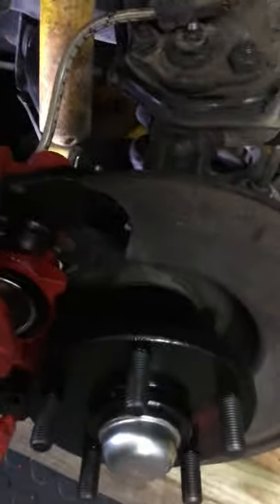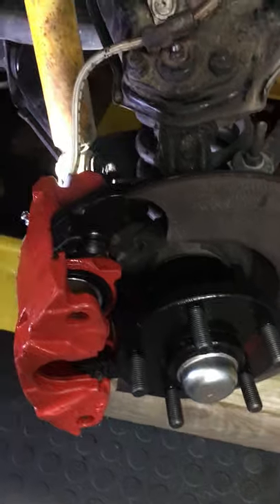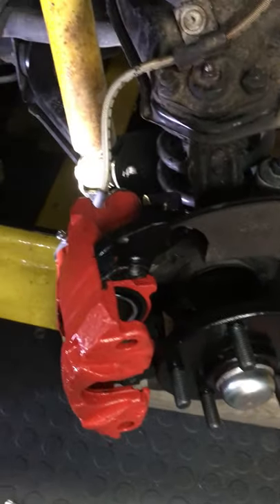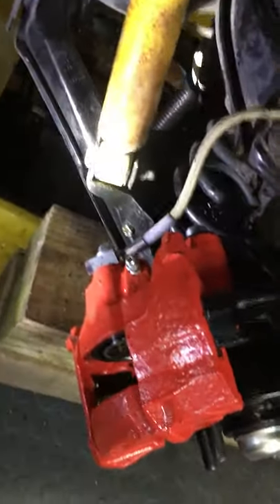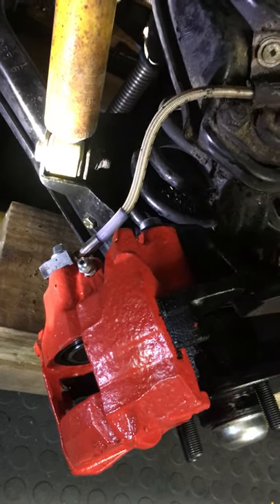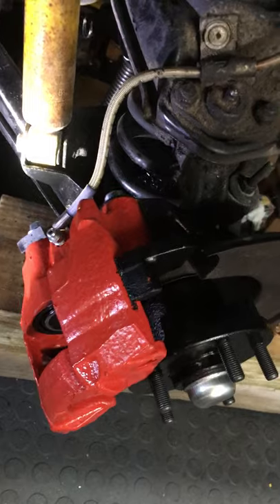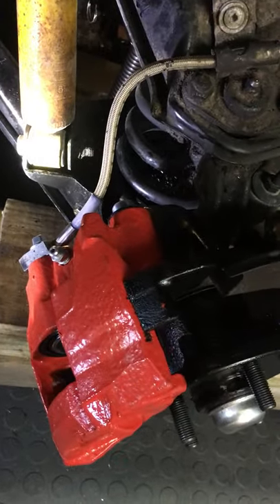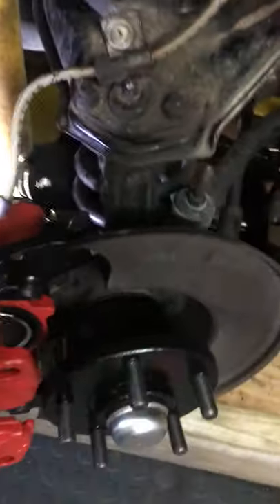There are two things people don't always talk about. Sometimes they use spacers on the bracket because a part here rubs on the brake rotor, but spacers make the clearance worse when turning the wheel. Instead, I machined the bracket two ways. First, where the caliper attaches, I took 43 thousandths off to center the brake pads on the disc — giving about 17 thou clearance on each side. The pads are different thicknesses: one is 515 thou and the other about 615 thou, so 43 thou was perfect.